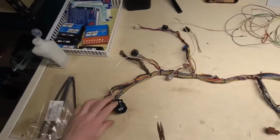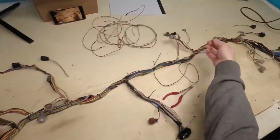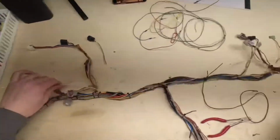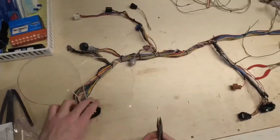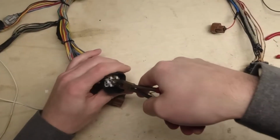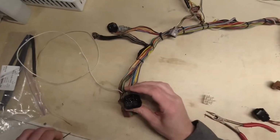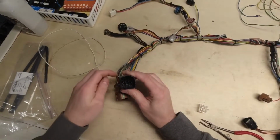But basically, to get these pins out, what you would do is this wire came all the way down here to that solenoid. So basically you just chase it and pull it right through all of your zip ties, and then you have it laid out like that. So your next step would be to grab a hold of the wire lock here. Some are different, but this one just pulls straight out. Pull it out, and what that does is it unblocks the pin locks down in this connector, and I'm going to try to make this as easy to see as possible.